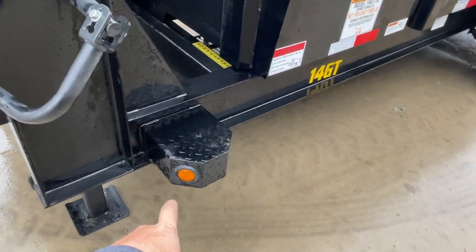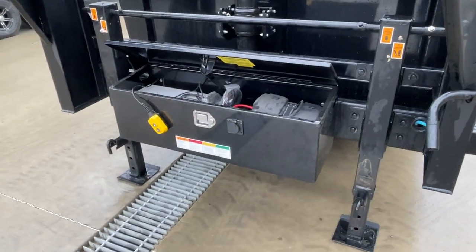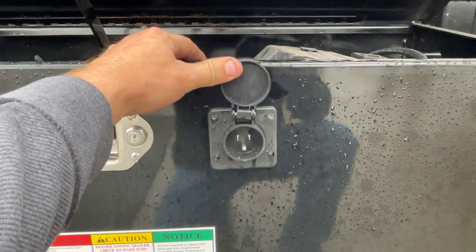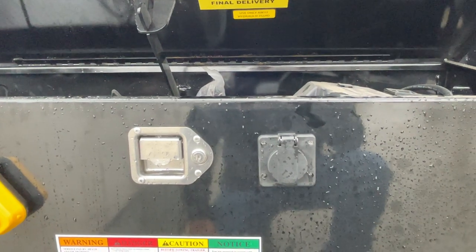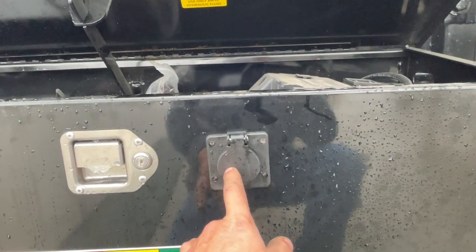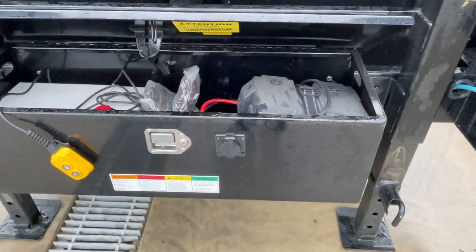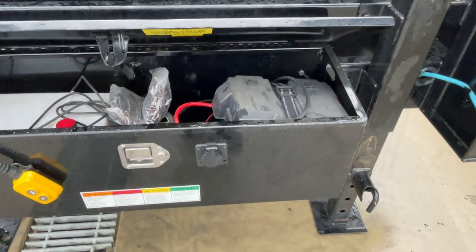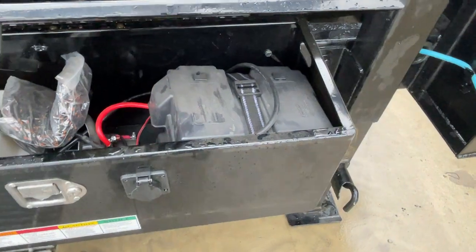You've got your integrated sidestep with your grommeted LED lights. Dual 12,000-pound jacks. It's got your toolbox with your 110-volt charger. If you're not familiar, this is a 5-amp charger — some are also a 2-amp, but this here is a 5. Normally you're going to have a group 24 deep-cycle marine battery, so that's a roughly 140-amp-hour. That means you would need about 28 hours on a 5-amp charger. If you plug a 5 in, you can do it in a full day, give or take — if it's a 2-amp charger, you're going to need more like a weekend. Your battery is in a separate battery box, so you don't have to worry about arcing from the battery.